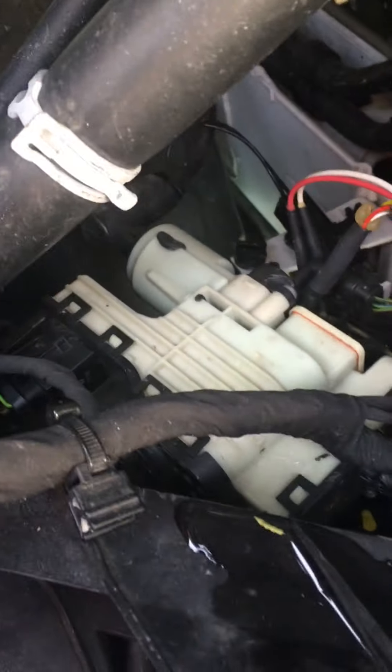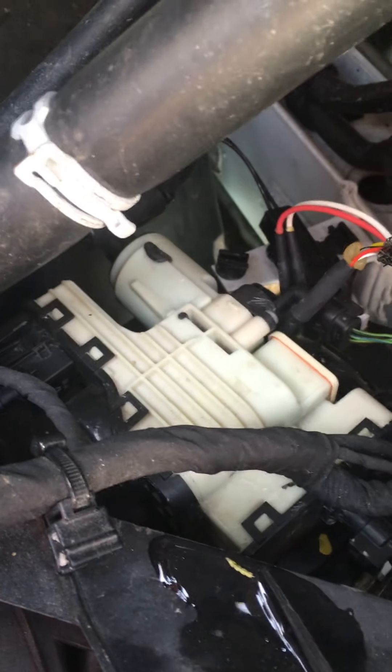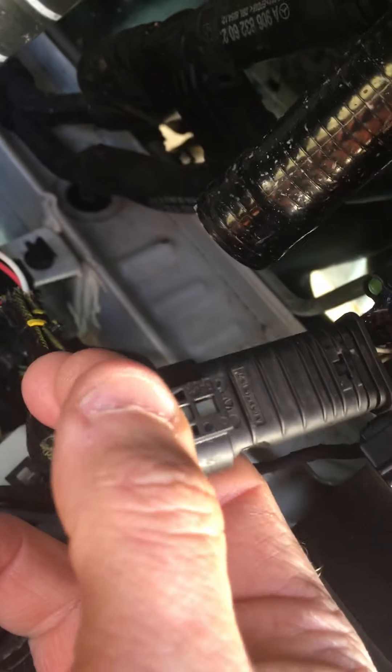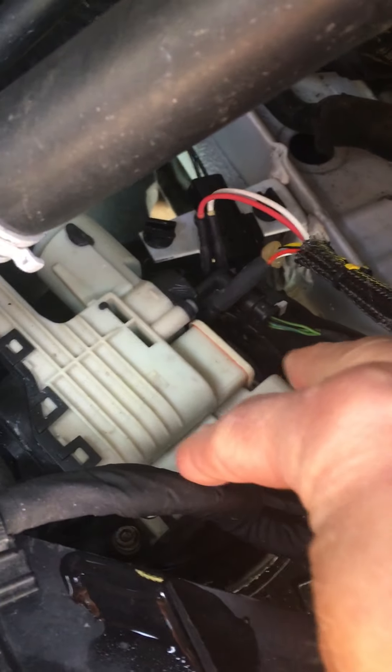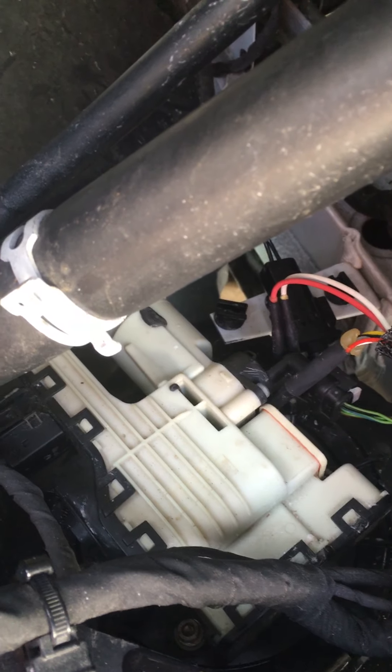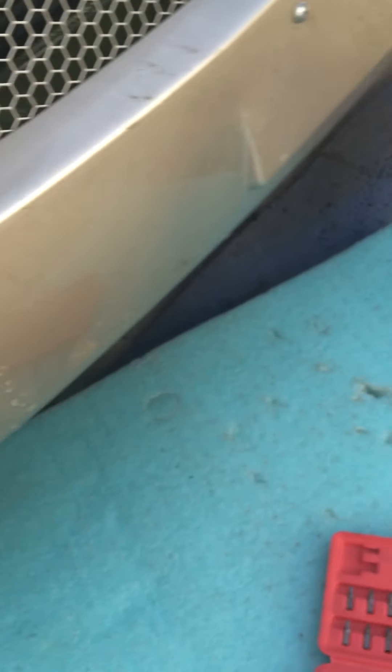It's a 5.8-gallon tank on these Mercedes RV chassis. There's a bunch of wiring connectors you have to take off — they're not that difficult. Pop those loose; you might need a screwdriver to get a few of them, popping the little locking clips back with a screwdriver and then pulling them out. The actual DEF pump itself only has three bolts — two here and one in the back.